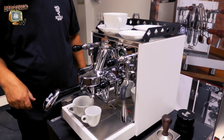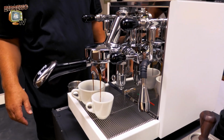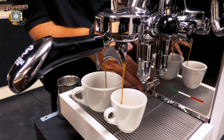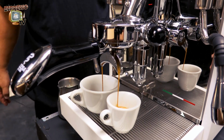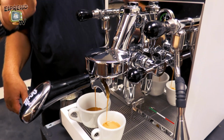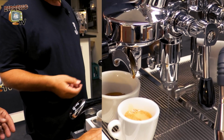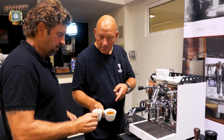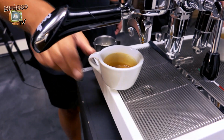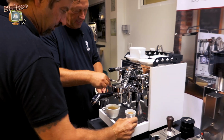Okay, now we select our brewing, and you see the extraction. Here is good. Here also runs out water from the pump, because the vibration pump pushes at 15 bar. So according to the setting of the OPV, the difference between the 9 bar and the 15 bar is discharged by this pipe. So in case the crema looks nice, I don't try yet because I still do something. And before I steam, I always remove the condensed water, okay? Of course. And so I try.